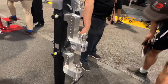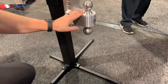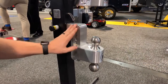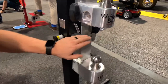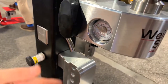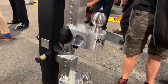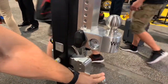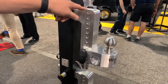Most buses are going to use a two-inch receiver. These come in four, six, eight, and ten inch drop sizes. A six inch drop is what you'd see at most half-tons, and most buses are going to be in the four to six inch drop range. These are rated for 10,000 pounds and are solid billet aluminum with no welds anywhere — that's how they achieve such strength from aircraft-grade aluminum. Everything is either stainless steel, which won't rust, or 6061-T6 aircraft-grade aluminum.